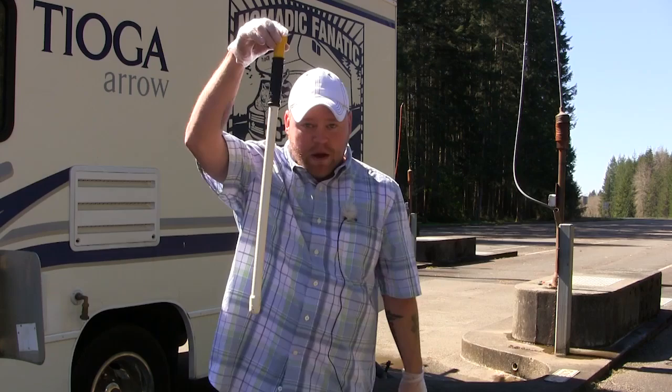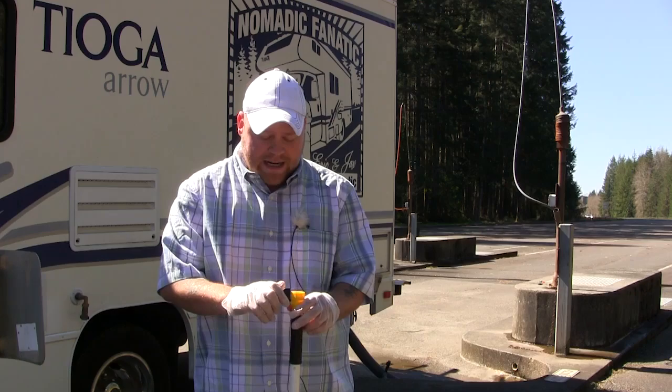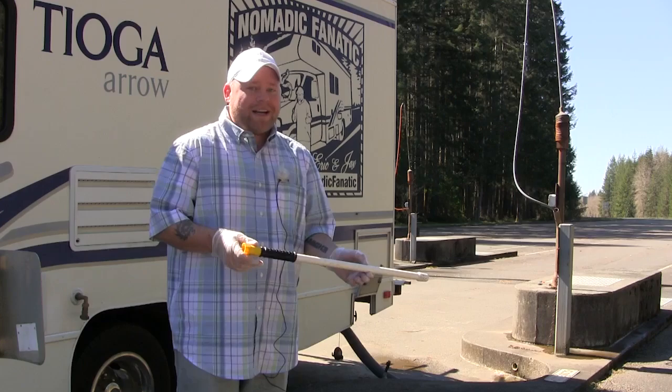This drops down into the toilet inside your RV. And then you turn the water on, open the valve. You're pressure washing the bottom of the actual tank and you're getting any gunk that may have been left behind out of there cleanly. That process alone can take another 5 minutes added to it. Like I said, I only do it once every eighth time. It's not necessary. It's okay to have a little bit of leftover stuff at the bottom of the tank.